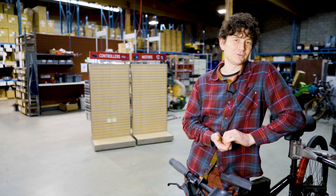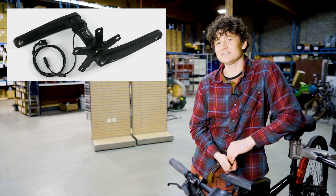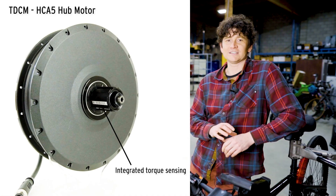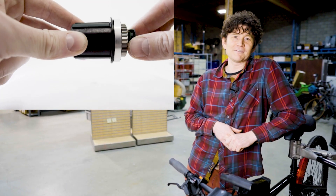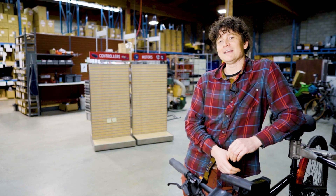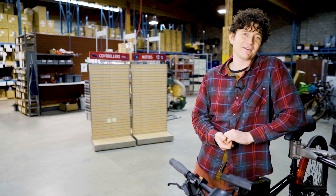Finally, we've added a whole new torque sensing control mode — the ability to support not just the bottom bracket torque sensor but a wheel-based torque sensor. There's an increasing number of hub motors coming to market with a torque sensor integrated into the rear motor, measuring torque in the cassette free hub body or in some cases on the bending of the axle. This differs from a bottom bracket torque sensor in that the computed power for how much you're putting in is not a function of your pedal cadence.